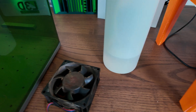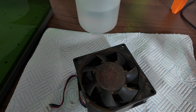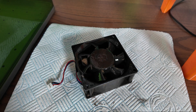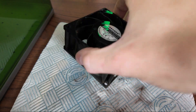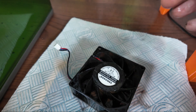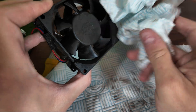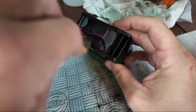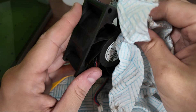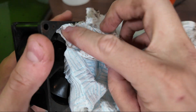This part is going to be a bit of a different story because it's got sensitive components in there — we don't want to be getting it wet. Lay it on a surface so that when the grime runs off, it's not too bad. Spray it with the IPA — isopropyl alcohol — and I'm not being sparing with this, I'm just getting stuck in. Just make sure you don't get the connector. I'll get the brush in there as well, then get the cloth into any areas I can. The more thorough you do it, the better your fan is going to perform.